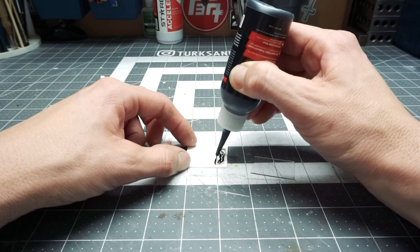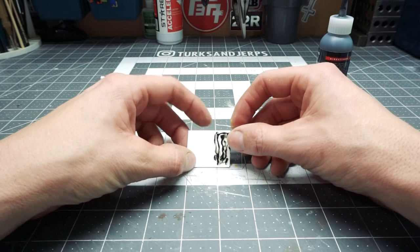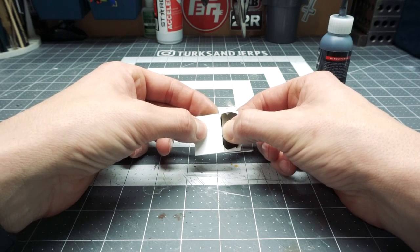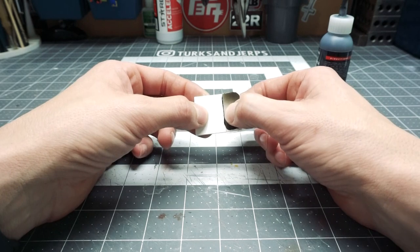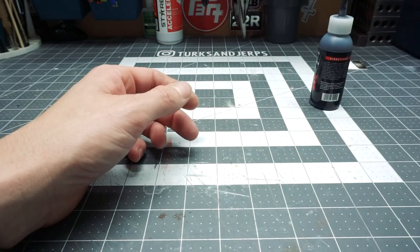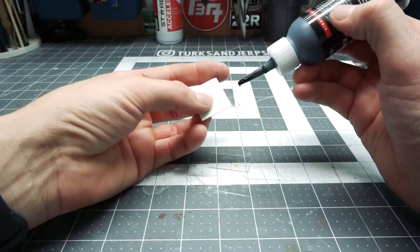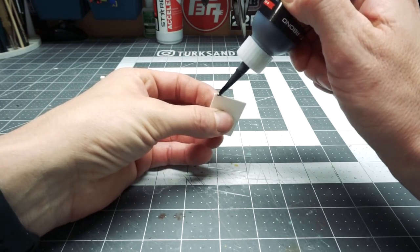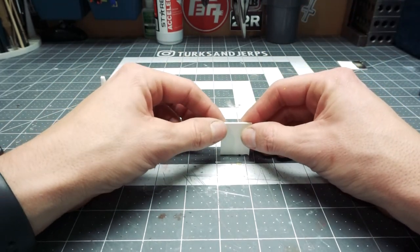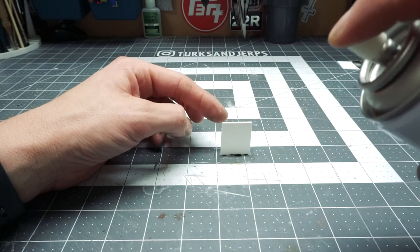It'll hold it together, but probably wouldn't hold on for long, especially with the flexing of the body. Obviously, you'd want to paint on the outside if you're doing this kind of stuff. You could avoid it entirely by just not using Lexan bodies. Now another thing. The CA will fog this clear plastic from the vapor fumes or whatever.